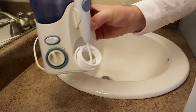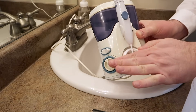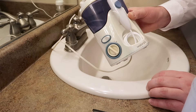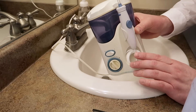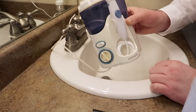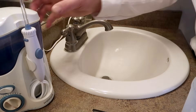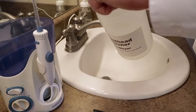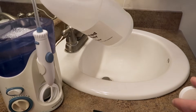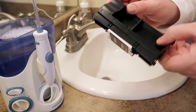What you're going to need is a water pick tool. This recommendation came from Mike with Precision Colors — he said use a water pick on the actual printhead. I ruined one printhead, and ruined another entirely, not using this method. I tried an ultrasonic cleaner and that really trashed the printhead, so don't do that. What we're going to do is fill the tank with printhead cleaner. This printhead has been soaking 24, 36, 48 hours — you don't need to go beyond that. Keep making sure you fill it up as the liquid drains or dries up around those screens.